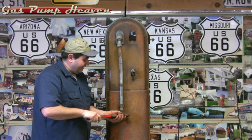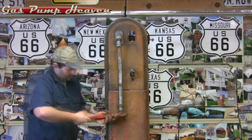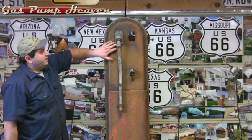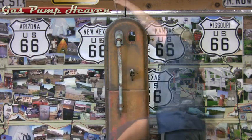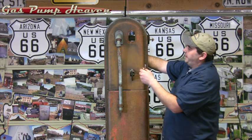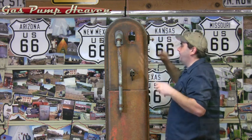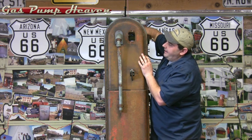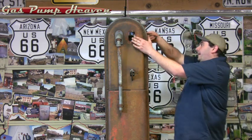Sometimes you can tighten it to loosen it. There we go. The next thing we're going to do is take these nuts off the back — these are seven sixteenths as well. Now this is only going to remove the plate that goes around this piece; it's not actually going to remove the whole thing. If something gets stuck, put the nut back on and lightly tap on that nut — that way you won't ruin your threads or flare out the top.